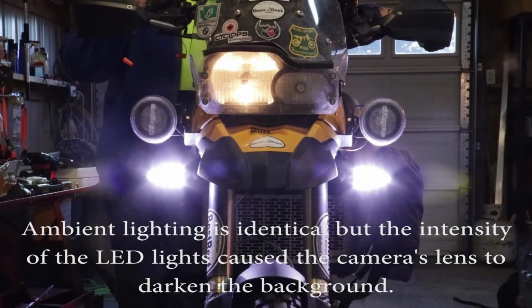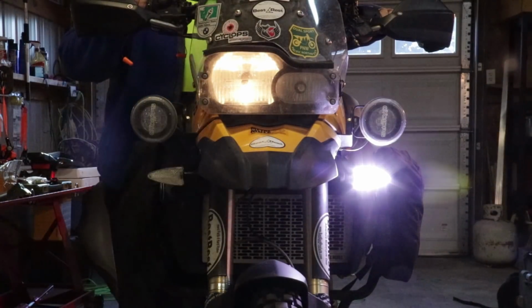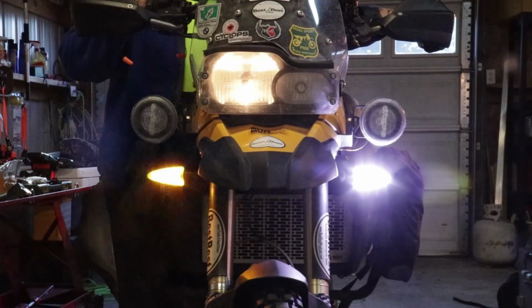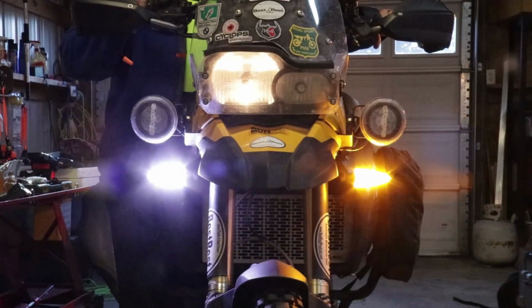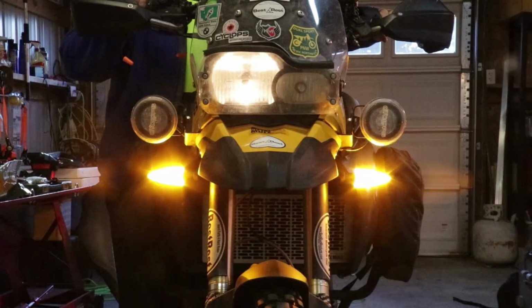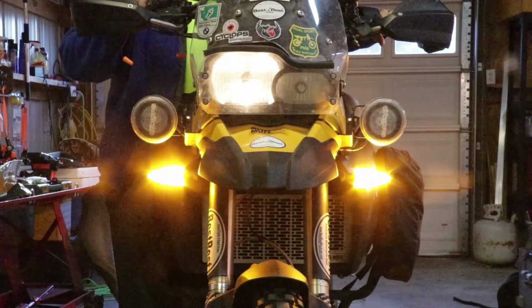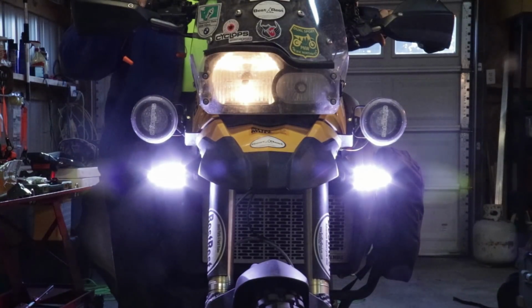So here we have the running lights showing white. I'm going to use right turn signal, and you'll see that the right signal is flashing yellow and the left running light stays on. Now I'll switch it. Left signal on and right driving light or running light on. If I go to emergency flasher mode, both of these signals still work in the same configuration, and as soon as I turn off the emergency flasher, they go white. So that's what we've done in the front.